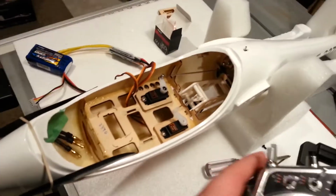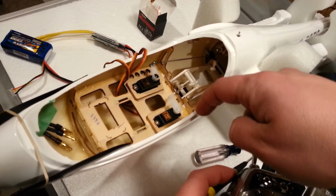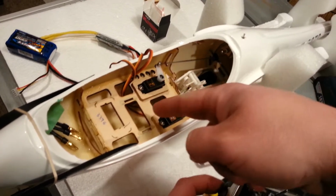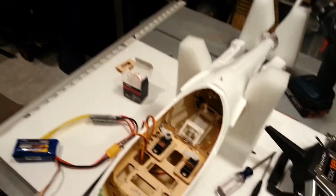Okay, so guys, I just want to show you what I'm thinking. See, when this comes back over and folds over to the outboard side, that's where we're getting our problem. So if I just had a longer linkage and I could take more of a linear stroke, we're going to have less problems there. So that's what I'm going to try to do real quick. I'm going to try to get a longer linkage. I'm going to see if I got another one real quick.